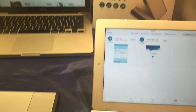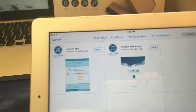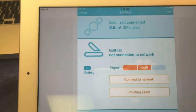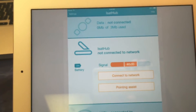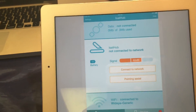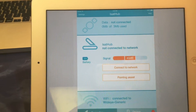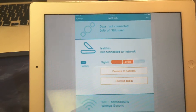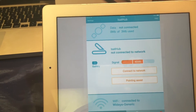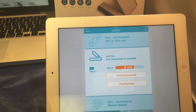At this point, go ahead and open up your control app. Once you get in, it's automatically going to ask for your username and password to start controlling the device. The default username is lowercase 'admin' and the password is '1234'. Once you enter that you can change it, but for now that'll get you into the control app so you can get going.